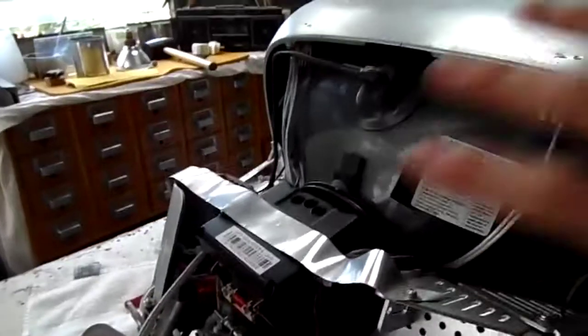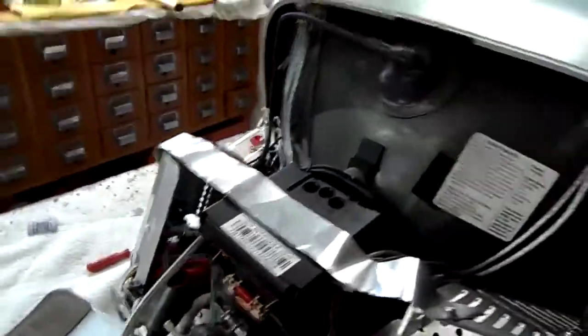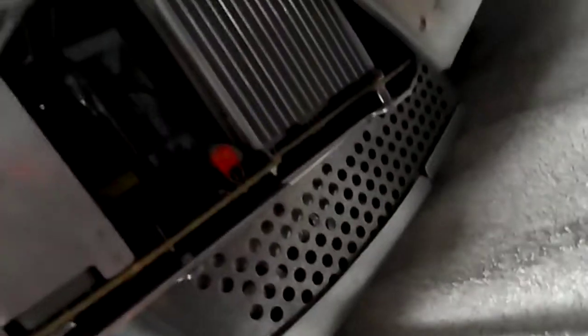I just have no idea at the moment. I've got a few theories — maybe that power transistor in there if I can get it out. The real bummer with this thing is the fact that I'll have to probably pull the CRT out, very carefully disconnect all of these grounding cables that go all the way over it, pull a whole lot out, and then very carefully get this board out — involving taking the front off, pushing that all forward, getting this board out — and then I may be able to get at some of these MOSFETs and transistors.